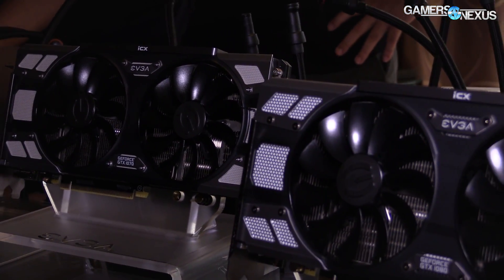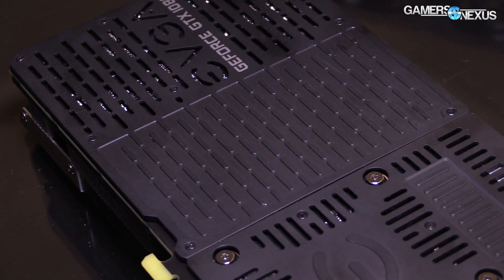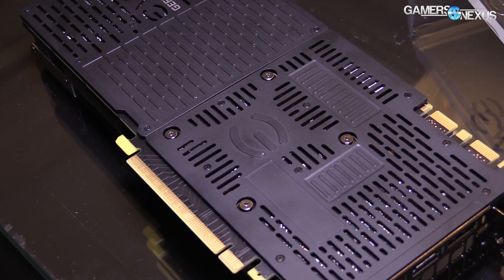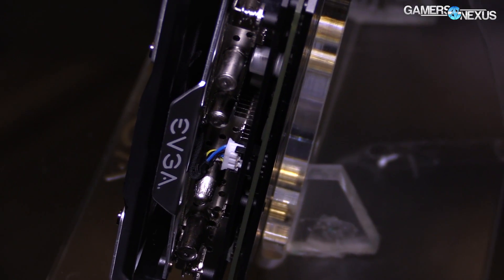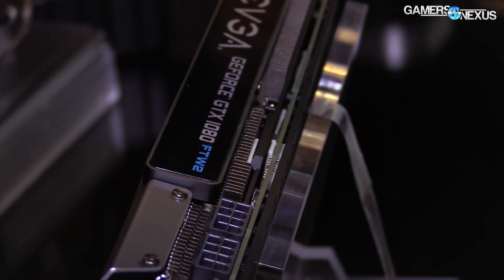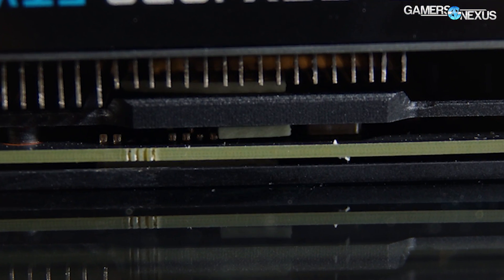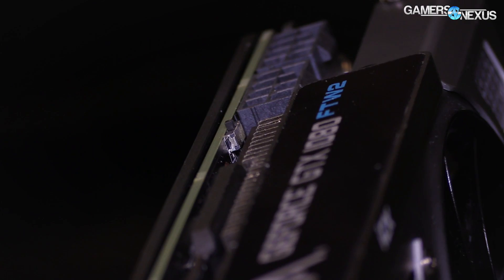We'll have more detail in the future. I have some basics I can tell you just from looking at it and observing, but they can't tell me a whole lot in terms of functionality under the cooler, and we weren't allowed to take it apart. The cooler has a fairly functional backplate in that it's all ventilated, which should help keep the backside of the PCB cool. Speaking of thermal pads, just looking down the side I can see thermal pads on the VRAM, the VRM components including the MOSFETs and the capacitor banks, and the chokes have direct contact to the base plate. So that should all be resolved with the ICX cooler.